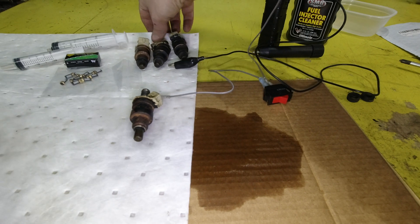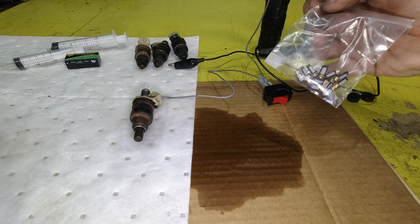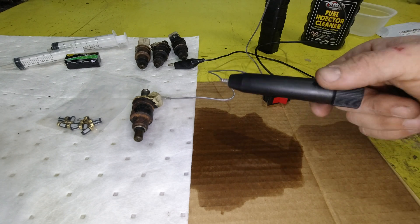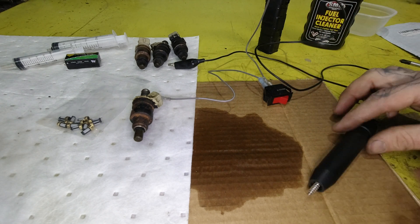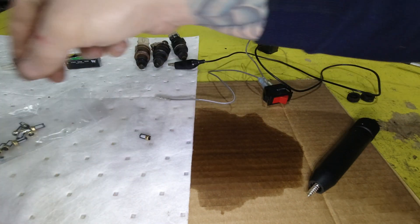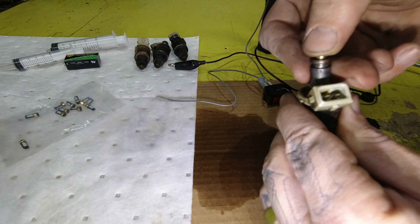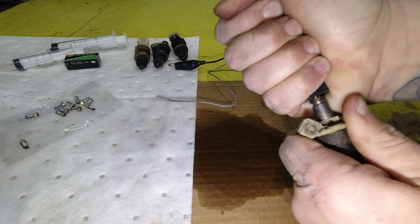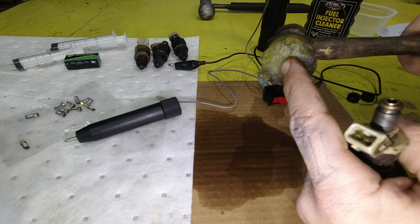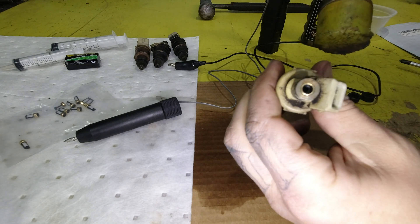Cost about two bucks for the tools — well, we'll say three, a dollar for the injector cleaner as well. And I got this package of 10 or 12 filter baskets with the tool on Amazon for I think it was $13 or $14 — I'll put a link in the description. Now to install these small filters, all that we have to do is clean this up a little bit, just put it in there and press it on home. Sometimes I like to take a hammer with a plastic head and give it a few taps until it's flush. And there we go — new filters installed. Now we just repeat the process.